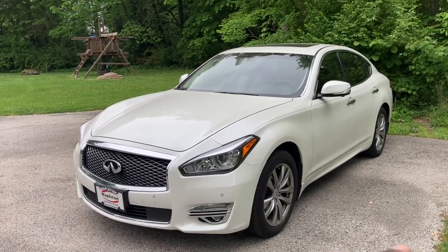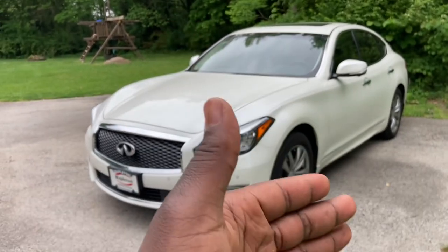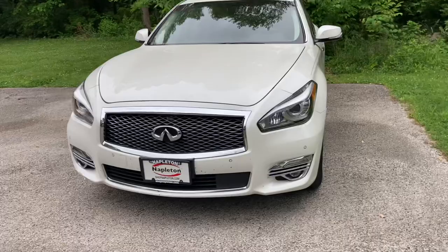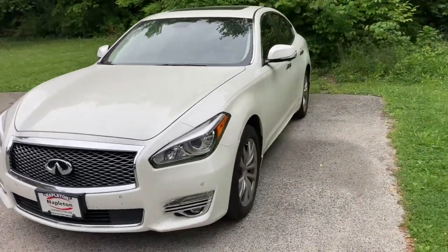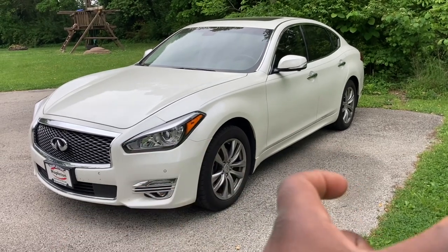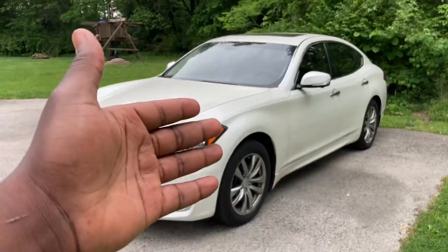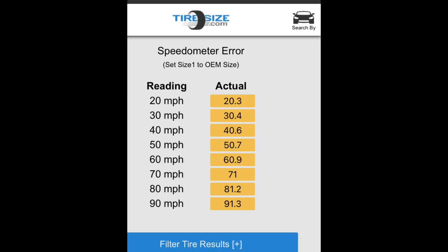The effective offset is more or less the same, just a difference of 2 millimeters further inset. But the width — the GTR wheels are 1.5 inches wider. If you think about it this way, it's like the flushness of the GTR wheel compares to using the base model wheel with a spacer that is three-quarters of an inch thick to make it poke out a little more. The effective calculated poke is like 17 millimeters, not too bad. Because the offset is pretty much the same, you don't really have so much of the wheel hanging out — you have an almost equivalent amount extending towards the inside: 17 millimeters on the outside, but about 21 towards the inside. The tires change in size too, but not significantly, and the speedometer is pretty much the same.